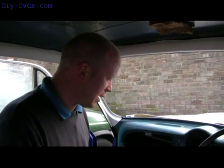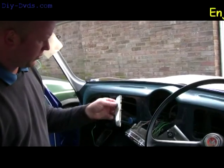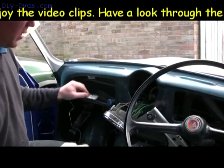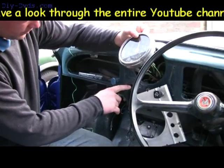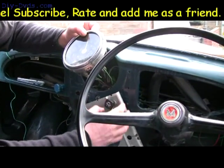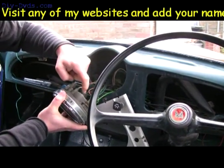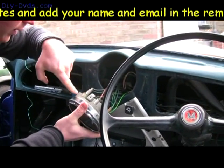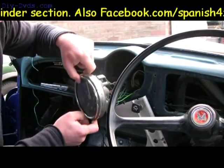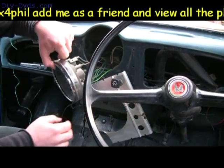Now I've started to pull the dash apart on the Morris Minor. You've got two of them, which you've got one, two, three. That one's come out. Three screws in the side. And you have to undo the front of the switches. All of them. One, two, three, four. And the choke cable. And if you really want to take it all off, you can mark where the bulbs come out and pull all the wires off. Take the dash clock off. This bit has to come off with the choke cable, so at the moment I'm just leaving it hanging there,